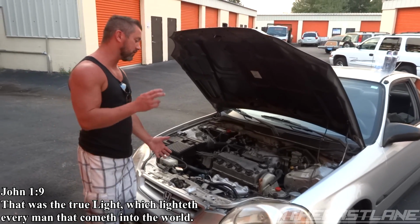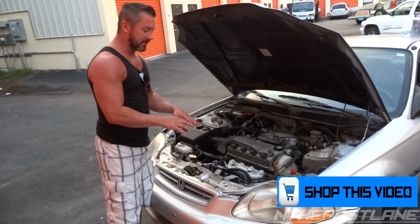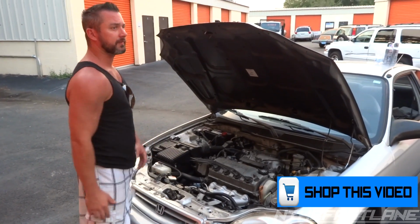In this video, I'm going to show you what to troubleshoot on this '96 Honda Civic Coupe. Basically, it has high pressures on the gauges. On your low side, it's low. On the high side, it's like 300 and something.